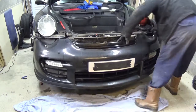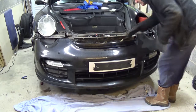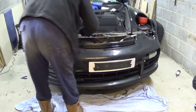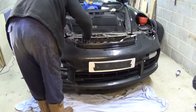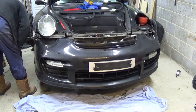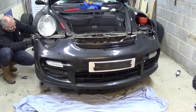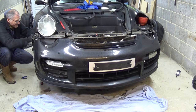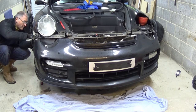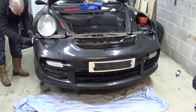She's loose. Still not convinced. Right, that red wire, yeah, it goes into a right mess down here. So, I'm gonna. Oh, there's a connector. Is it a connector? No. It's a right mess, this. So, I don't know if I put this in, but what I'm gonna do is cut that red wire. Is that a connector? No, it's a crimp. That's a crimp there. That's fine. I'll cut it and I'll change that and put a proper connector in. So I'll just have to remember that when it comes to putting it all back together. So what I'll do, I'll just take that red wire to that so I remember it.